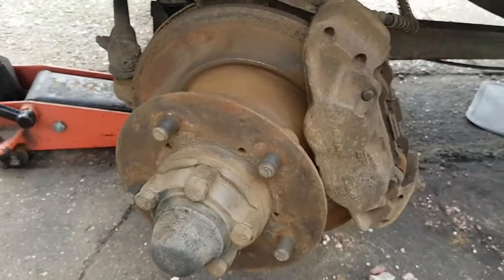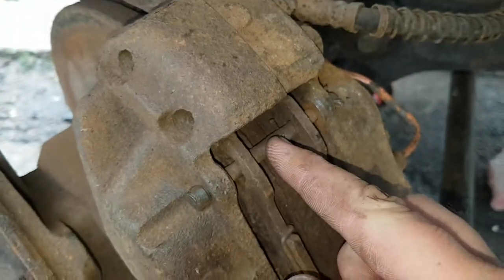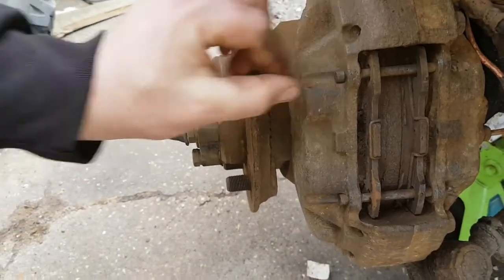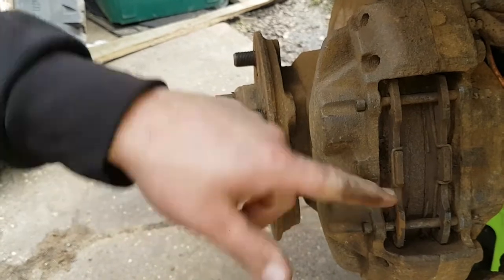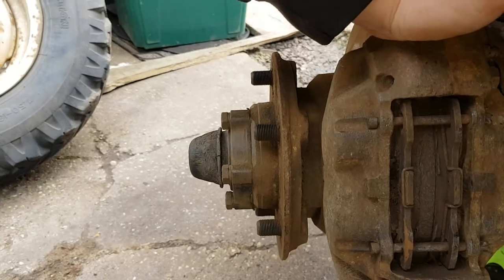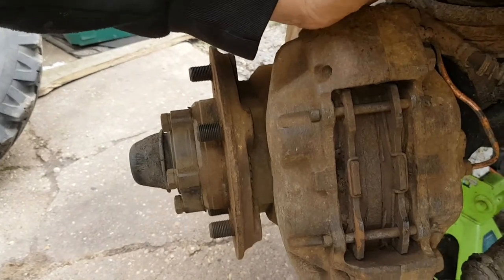That's the first side done. Now what to do is get these little split pins out, and then this whole pin — you get that little pin out, split pin, and then this will pull out. Do the same thing down there. Watch out for these little clips because you don't want them flying off into oblivion. Carefully pull the pads out. Obviously clean up the area inside and check the pistons for any damage.